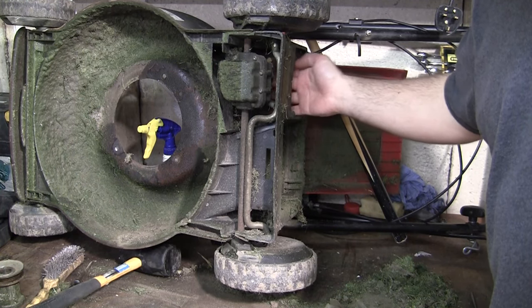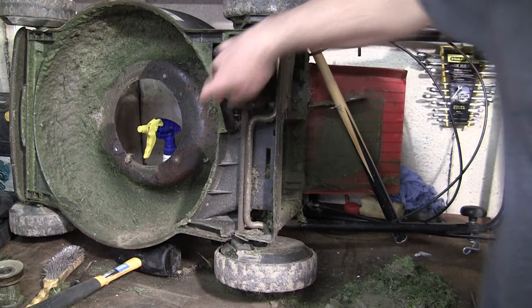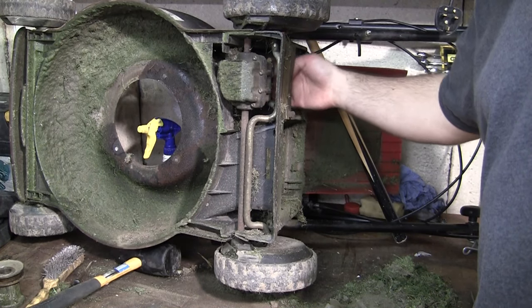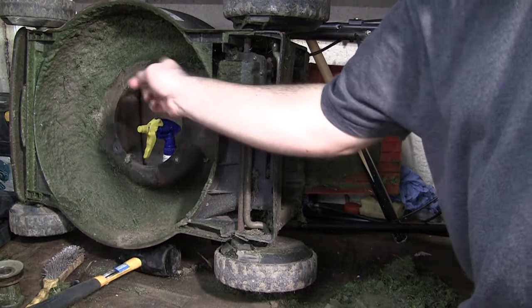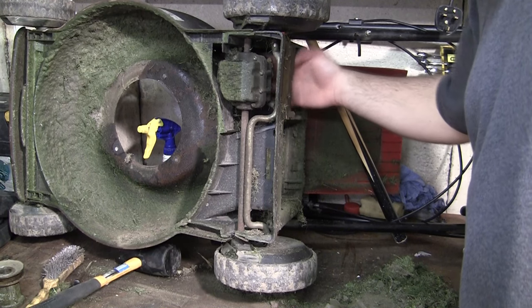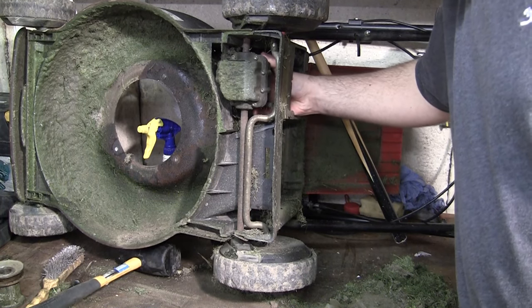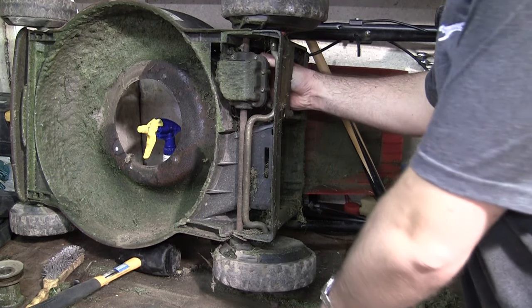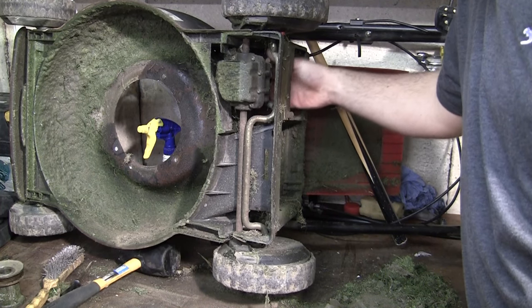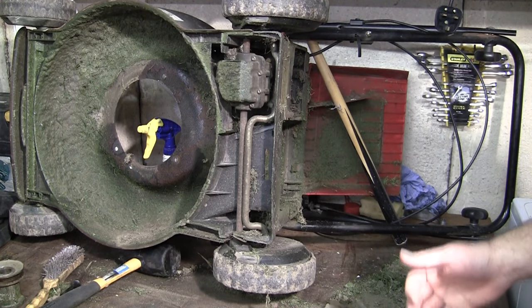These all work in a similar way. They all have a pulley on the back here. There's normally a drive belt that runs around here to the blade. When the lawnmower's just running, the pulley spins and the belt goes round, but the wheels don't drive until you want them to. There's a little lever — if you press it forward and turn the wheel, you can see the wheel start to turn. Once it's engaged, that wheel turns; let go and it doesn't. That's basically how these transmission boxes work.